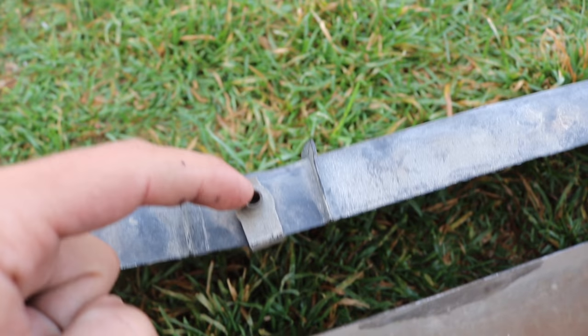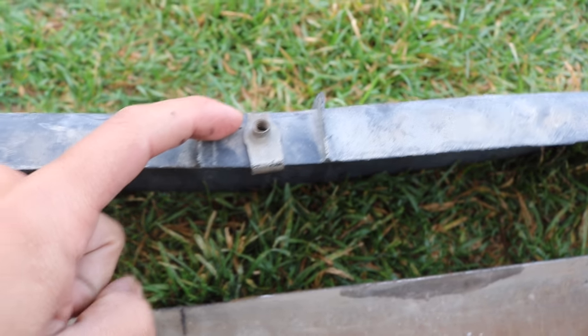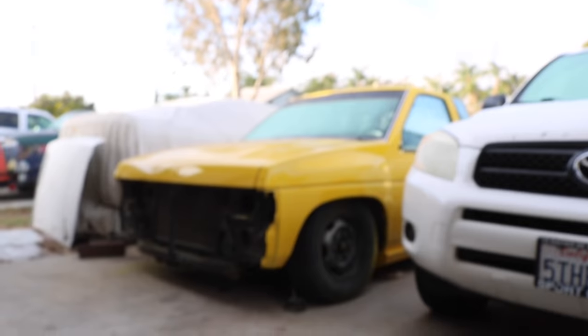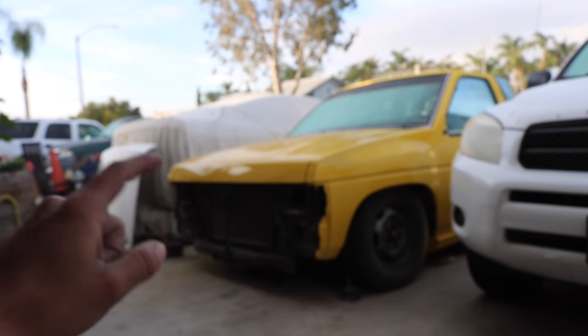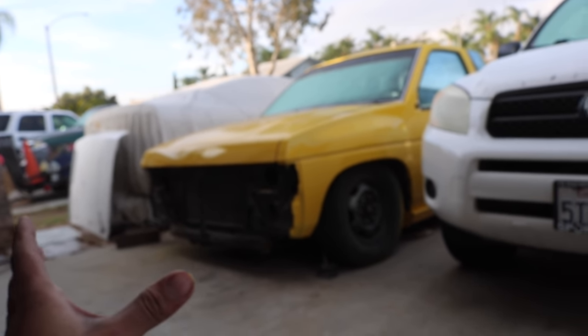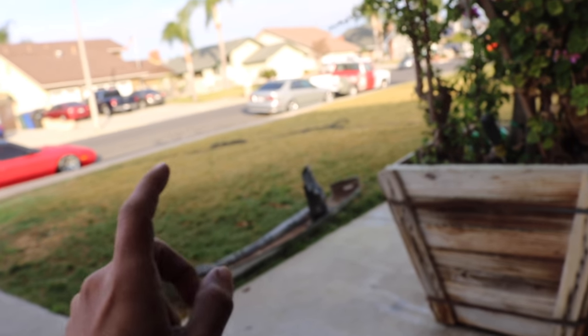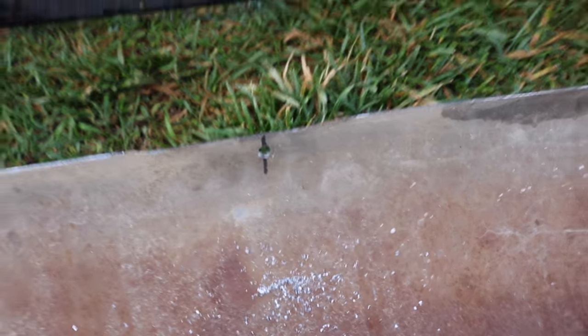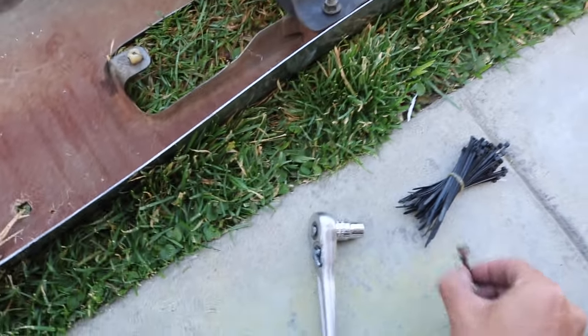I'll drill a line down the center and measure from here to where this hole is — looks to me like about three quarters of an inch. So I'm gonna measure from the edge three quarters of an inch in and drill a hole. I'll also have the Ranger valence install link in the description. I like that lip because it fills up the whole bumper, but I like this one because it hangs lower. I have a little pilot hole on center and I'm gonna drill a quarter inch hole and use the factory hardware from the junkyard.